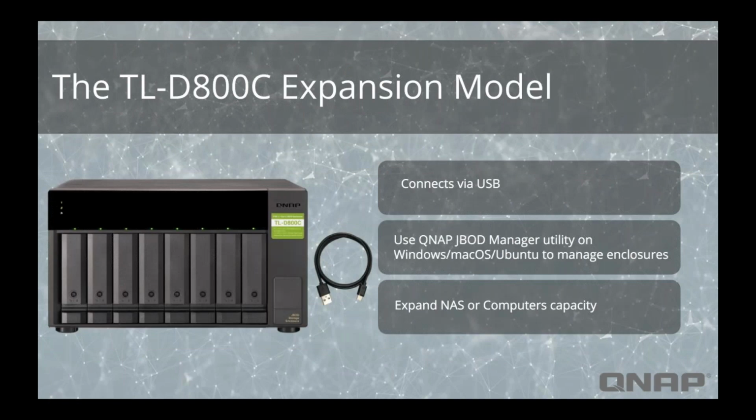Another USB-based expansion unit is the TL-D800 expansion model. Also, like the TR series, this unit can function as external storage for individual workstations. It does not include a hardware RAID switch and does not run a hardware RAID. This unit can either use the software RAID of the QTS operating system, or it can use QNAP's JBOD Manager, which is another application that can be downloaded to your Mac or PC from the QNAP utility site. Something to keep in mind is that this application does not itself handle the RAID configuration, but rather the software RAID of the host device